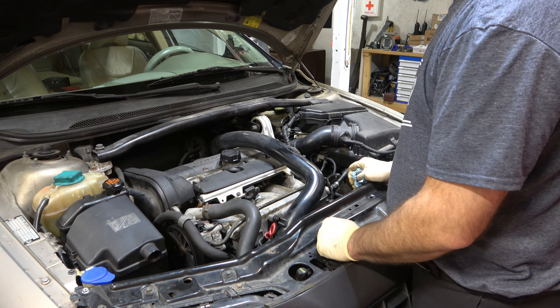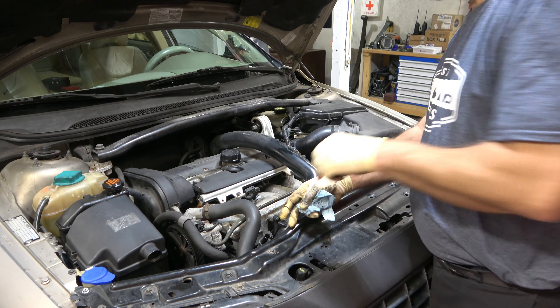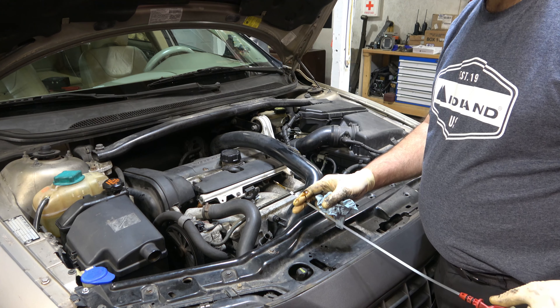After checking for leaks, the last thing to do before pushing this thing out the door is to double-check the oil level is correct. I'm going to wipe the dipstick off, stick it back in there and check it — and look at that, right to the fill line. So that's it. That's how to change the oil on any '99 through 2007 Volvo. The '98 and earlier — '98 to about '93 — 850s and S70s had a spin-on oil filter, but honestly that's the only difference in the job. Filter, gaskets, and oil all cost me less than $25, so cheaper than anything you can do in town. And you get the pleasure of knowing you did the job right. Anyway, that's it for today — I'm Eric, owner of Far Point Farms Restorations and Repairs. Hope you enjoyed the video; hope you'll like and subscribe.